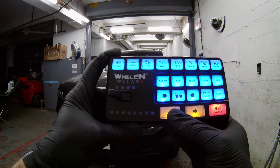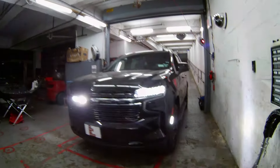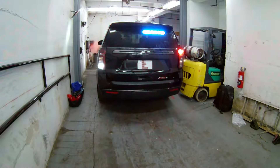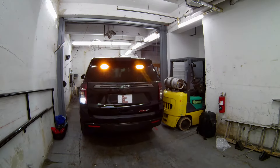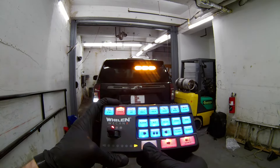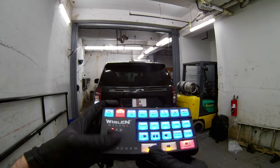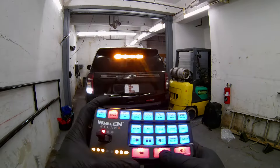That covers the clear button. Next we have the traffic advisors. Jumping back to mode two, the front and the rear third side window flash in red/white — same pattern as slide switch three. In slide switch one, we have the traffic advisor programmed. This is a dual-color bar in the rear. The two buttons illuminate and activate the traffic advisor. The user can turn off one for right-only or left-only direction, both on gives center-out, and both off turns it off. In slide switch one, only the white lights flash, as opposed to the lights combined with the brake flash pattern.